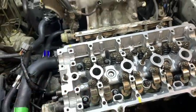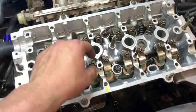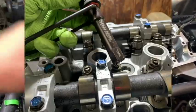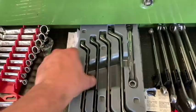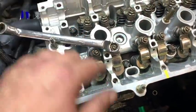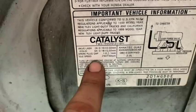It's no surprise that we had two that were completely stripped out - half the caps were loose as it was when it came in. I'm going to show you a tool here - it's a 10 millimeter with a flat head, but these are 12 millimeter with a flat head. You can use something like these Craftsman offset ones like this 12. And then as you're adjusting the lash, you put this on here like so, with the feeler gauge tucking up underneath, and then it gives you your valve lash up here.